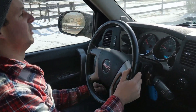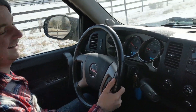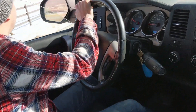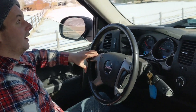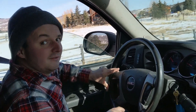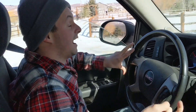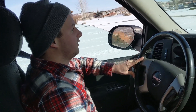We went out for a drive test to confirm the compressor cycles properly when you honk. We gave it a couple of blasts — it's fairly loud. The compressor kicked on after the horn fired. In about 20 seconds it should turn off. The way it works: if you honk and tank pressure drops below about 85 PSI, the compressor kicks on and charges the tank to about 105 PSI, then shuts off. And the compressor just turned off — I'm calling that a successful install.